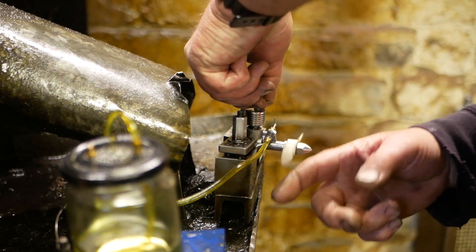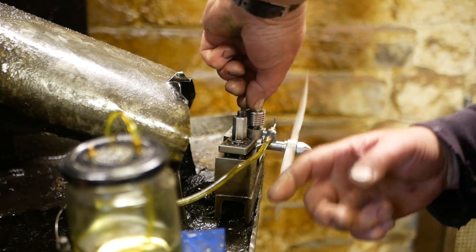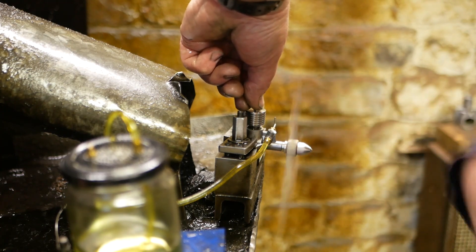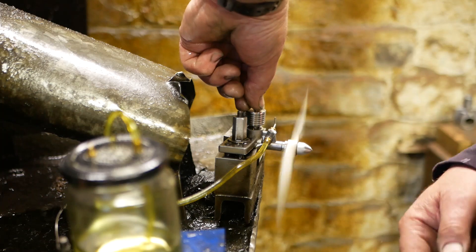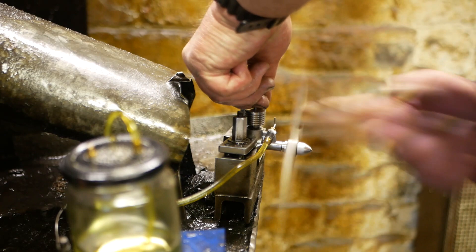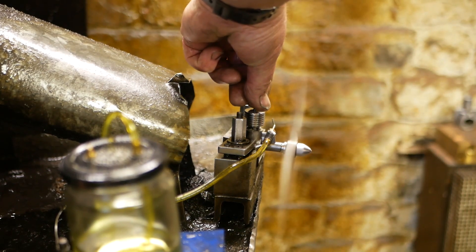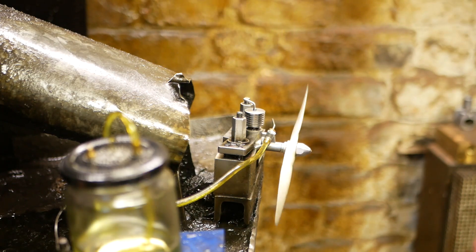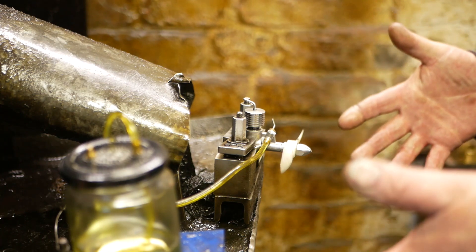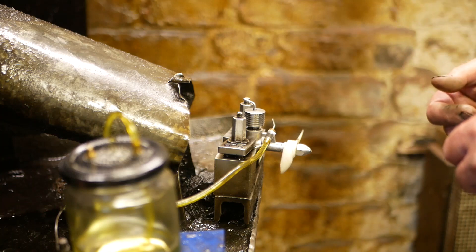So again we have to chase the fuel out by increasing the compression. Once it starts to fire like that, if you now return the compression down to its original starting position, you can hear — as the engine started up rich, the engine was bogged down and the revs were low. Then the revs rose as it cleared the excess fuel out, and everything was fine.